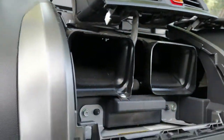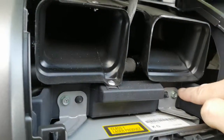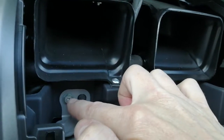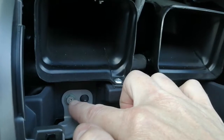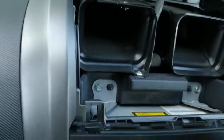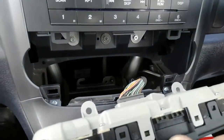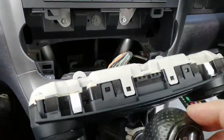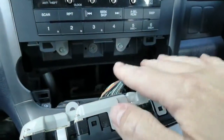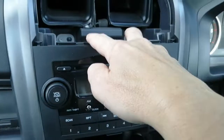So let's put that up there out of the way — this gives you access to the other two mounting screws just here. Now we're going to remove these next. This is a cross-head Phillips screwdriver. If they're really tight and you think they're going to round, you're better off using a seven millimetre socket to unscrew them. If you're on an automatic, you're best to put your parking brake on, put your ignition on, and pull the gear lever back so you've got some extra space. This one being a manual, I haven't really got that problem. So we're going to go ahead and undo those two bolts and those two bolts.